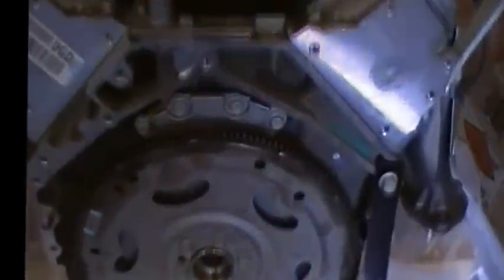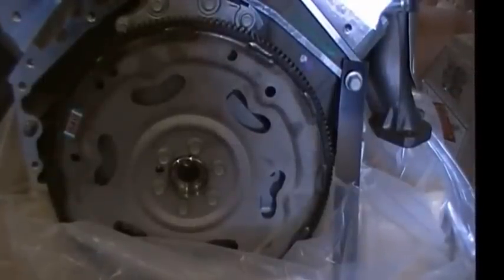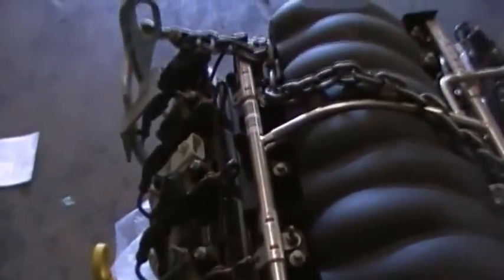This is the flywheel you want. I've seen these engines come through with manual flywheels and pilot bushings, but obviously we don't need that with a 6L80. So if you don't get this flywheel, just get a standard flywheel for a half-ton truck, 07-13. A lot of these engines come through with lift brackets — try to get lift brackets to spread the chain from hitting the intake, especially on the truck motors. The LS3 does require Dexos oil, which basically is Mobil 1 5W-30. The truck engines don't require it, but that's what GM recommends, so that's what I would run.